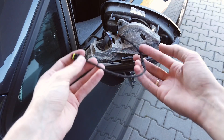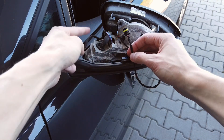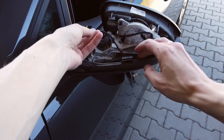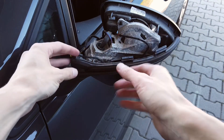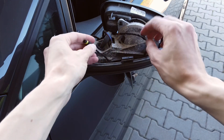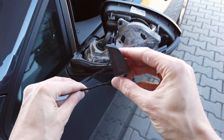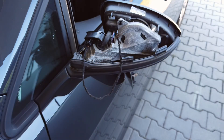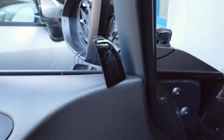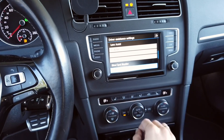You can see there's a lot of wiring here, which is actually a good thing — if you are going to keep the blind spot light permanently attached to the cap, you want this extra cable length so you can replace the cap without pulling on the wiring, and there's a lot of room to hide it. Before going further, let's connect the light and check if it actually works. Ignition on — and it's working. So I believe we can modify the cap now.